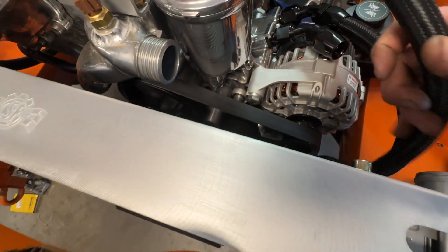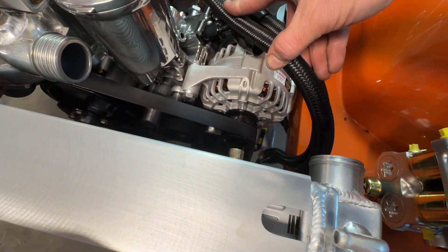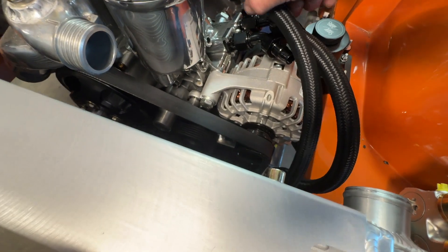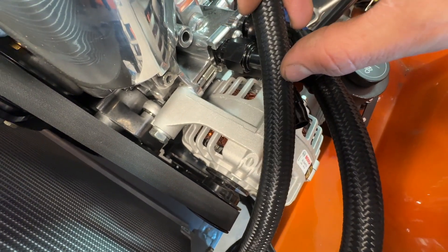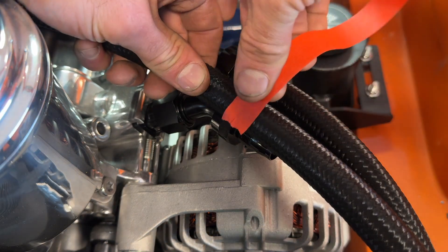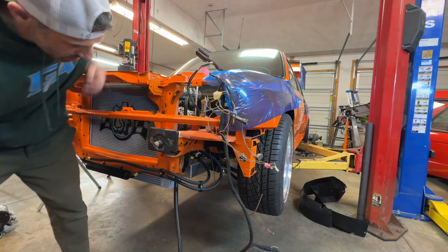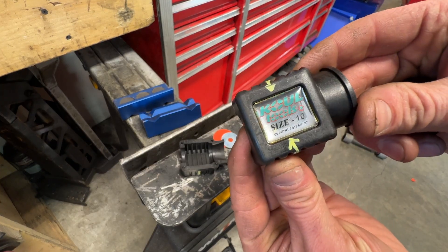Bottom installed and I've got this clocked correctly the way I want. I'm obviously going to need to find a better way to hold and harness these tubes, but that's okay. I kind of want this to swing in this direction — the important thing is I want to take this off, and this guy is going to end up getting threaded onto there, probably looking something like that. So I want to mark with tape exactly where I need to cut this line — I'm going to use some tape, mark it, and cut it. I felt it was appropriate to do a voiceover for this: I marked with red tape, and the reason you do that is so that when you cut the lines with a cutoff wheel, the outer braid does not fray off. That plays a really big role when you end up installing the line into the fitting.